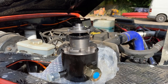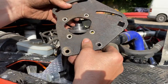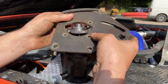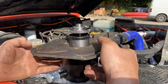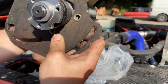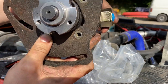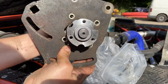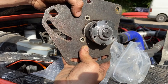On your off-the-shelf pump you're going to need your mounting plate. To get this on, put the big half on that side first and use those notches to slide it over the top. Once you've got your mounting plate on, your pump needs to sit in the car — well on my one, which is a 200TDi, so if you've got the same pump as me, that sticks down and sticks out to the left hand side, or the passenger side of the car. Then your mounting holes all line up like so, and this side here is the side that mounts into the framework of the engine.